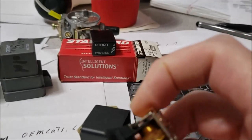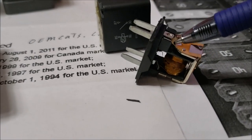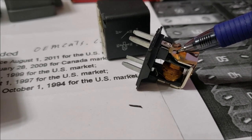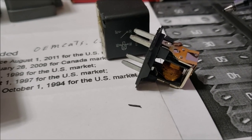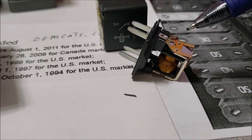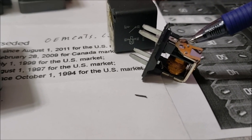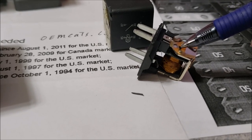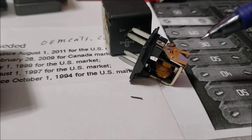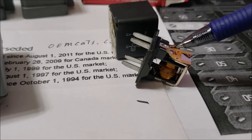Because actually the points are right in here — that's your points, there's your magnet. You turn on the ignition key, it closes down, makes connection, connects to the solenoid, and the solenoid engages the starter and off you go. So I imagine there's probably been many starters replaced on many vehicles — including the Workhorse — where the only problem was this little relay. A $10 relay could have got it up and going, but how many starters have been bought over this little part? That's where it comes down to proper troubleshooting, not just throwing parts at things.